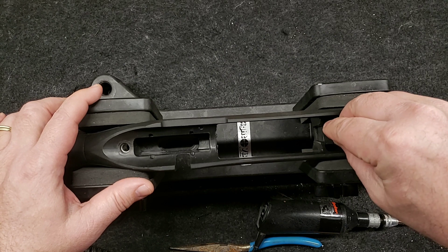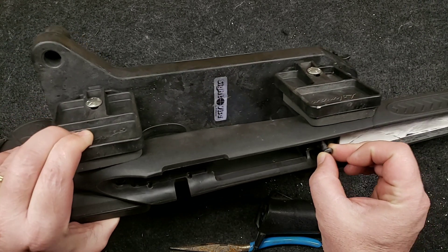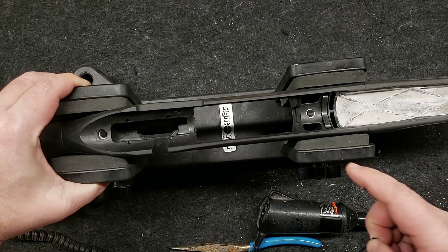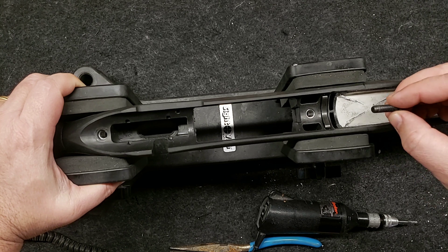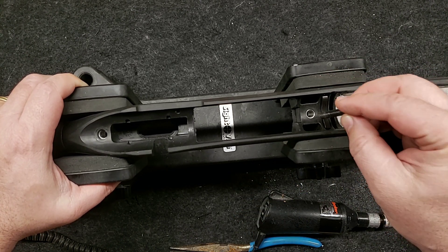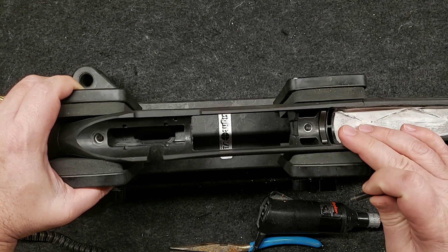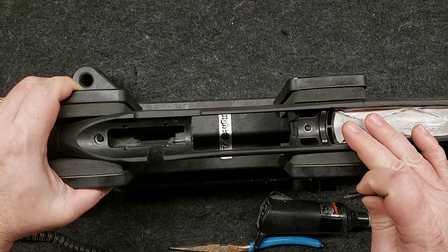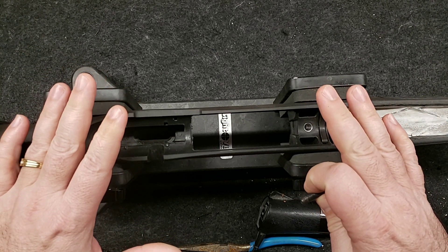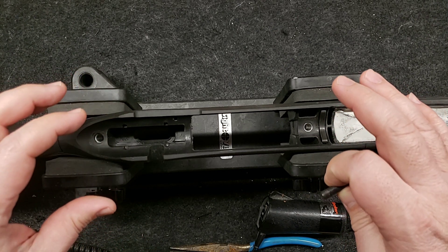They're pretty sloppy. You can see how sloppy it is. As I look down into the pillars, you can actually see where the screw threads were banging against the pillar on the inside and indenting it. I think that was happening on recoil. So I think this will help us a lot to keep the receiver in its proper place inside the stock.